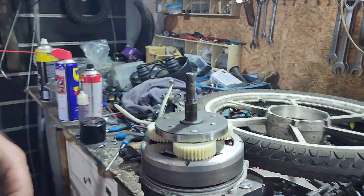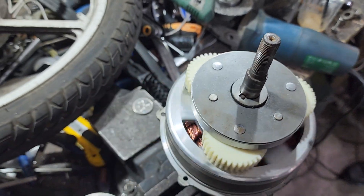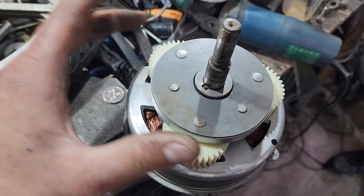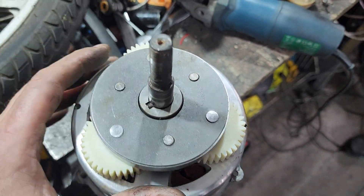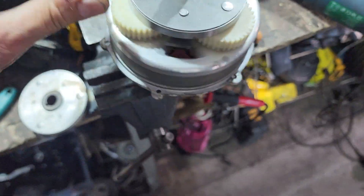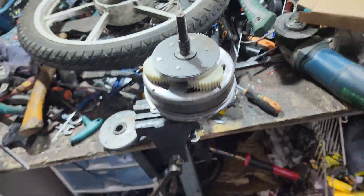Come on this side — you see right here, that's the keyway and that's the gear. That way when you spin it, it's working but it's not spinning the other way. It can spin this way, but this is the clutch inside, so no matter how much pressure I push, it's not going to go that way. And that's when you give throttle — it's going to spin.